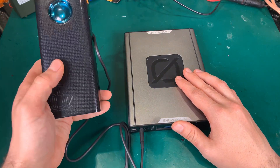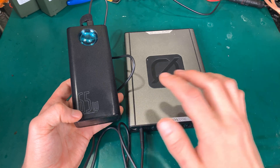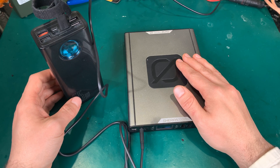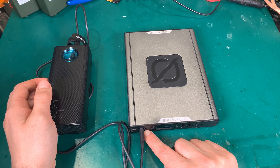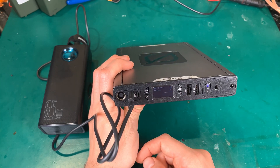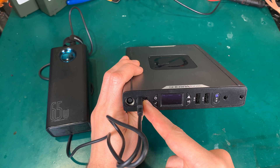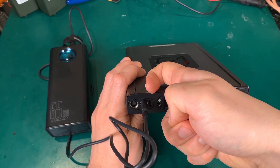In the other case, when we're grabbing around 50 watts from the AC or the ports or the Qi charger, this external power bank device is discharging while the internal battery stays at 100%. If I need more, I can grab another 100 watt-hour unit and plug it into the second port. I've got it configured so the first port is always input — anything I plug in charges the built-in battery — and the other port is always output, always recharging anything I plug into it.